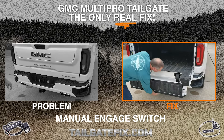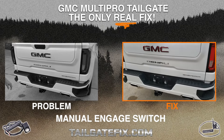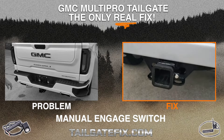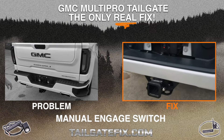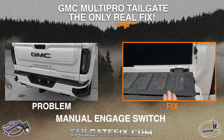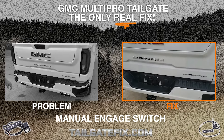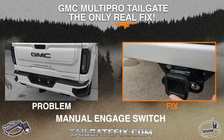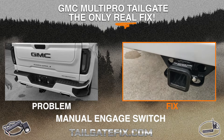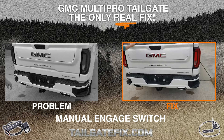He drops the tailgate normally and the mid gate goes down just like it should. That demonstrates how the manual version works. The manual version allows you to manually control the power to the mid gate of this MultiPro tailgate by simply punching the button on the switch, whereas our automatic version automatically does that for you. If you like to use the MultiPro mid gate when the tailgate's up for putting stuff in and out, the manual switch may be the option. If you use a decorative receiver cover with a locking pin, the manual version might be for you because the automatic version would think there's a hitch in the receiver.